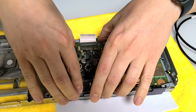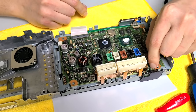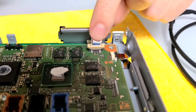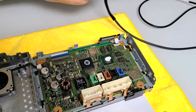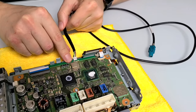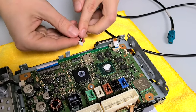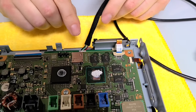Once it's lined up, press it down and put the screw back. Plug the antenna back in. There are two video cables — this is the big one. Once it's in position, close the clip, then do the same on the other one and close that clip back. When everything is plugged in, the last step is our video cable which will come out and connect to our module. Plug it into this connection right here, making sure the flat end is at the bottom. At this point the video cable is plugged in.